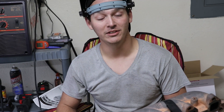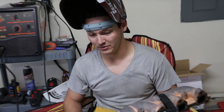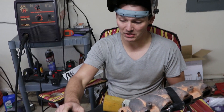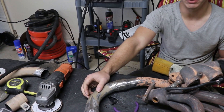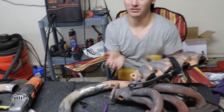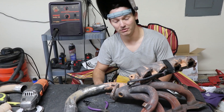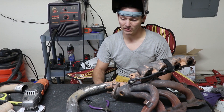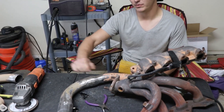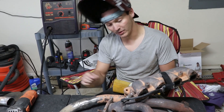Just a little update — it has been a couple hours later and we're having trouble. Gabe's tried it too. The metals are so thin and the welder just burns right through it really, really fast, so it's been a pain in the ass. Literally all I've been doing the last couple hours is filling in little holes, grinding it down, filling them back in, grinding them down — and then we should be done in theory.